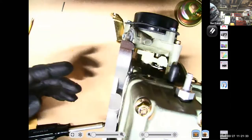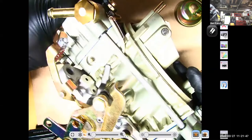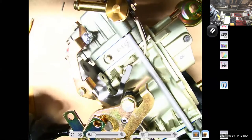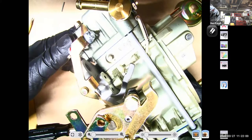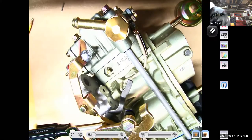All right, so everything has lined up exactly with my pictures in the presentation until now. If I look at my Holley carburetor, there are no mixture screws on the bottom of this thing. But wait a minute. It's got some screws right here on the sides on my metering plate. Well, what are those about? If you read the manual for the Holley carburetor, what you'll find is that these screws work the opposite.